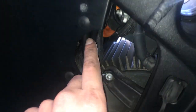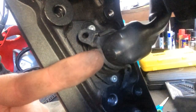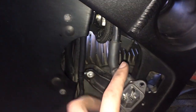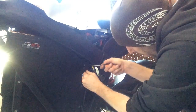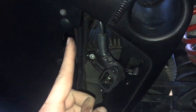To get the third cable off, follow it up through the frame — it loops up and comes back down to where the stock charge port is. You'll need to take this one off first because there's a whole assembly up there. On the inside of the charge port there are two bolts holding it in and they're 2.5mm Allen heads — these are really difficult to get to. The stock charging port is unbolted, and along with a bunch of other wires it's being held together with a clip. Just cut that zip tie and your cables will be free.